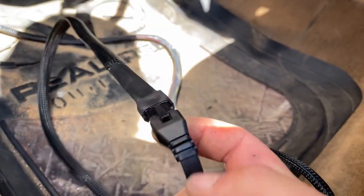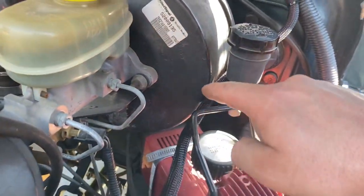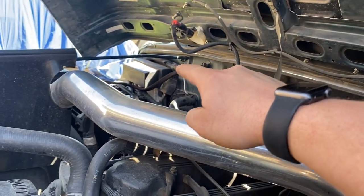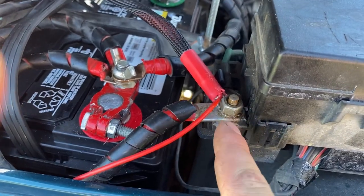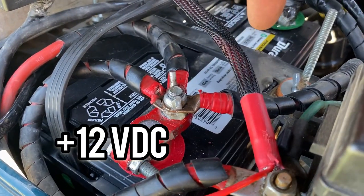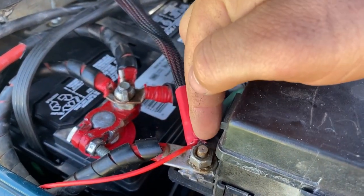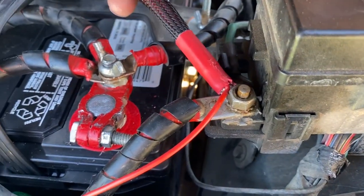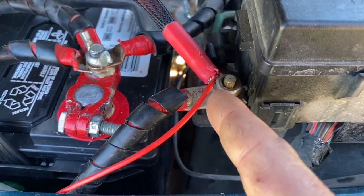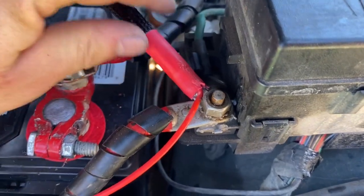The heavy power cabling for all the heavy loads — I've taken that cable along my firewall, the backside of the firewall, and I'm going to land it straight over to the battery. It's not directly on the battery; I chose this post here. I didn't want to put the switch box directly there because it's kind of crowded. I did have to oversize the eyelet on the end of this cable to fit this bolt, but once I did that, I was able to snug that nut down nice and tight and it secured the heavy cabling for that switch panel.